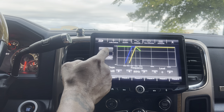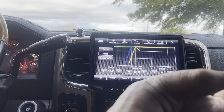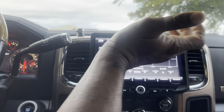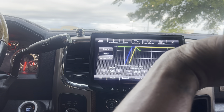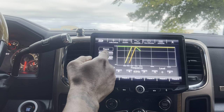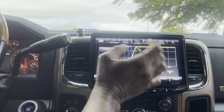As you go to the rear, because it's so close to the sub itself, I have it crossed down at 80 hertz — that's the crossover point where it meets. The mids in my rear doors — I don't bring that bass forward at all, because it's already handled by the subwoofer in the back. So I minimize it. I'm bringing the bass forward on my front speakers, but on the rear I don't need that, because then I'll get even more bass response. This is what sounds good to me.